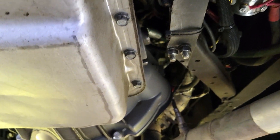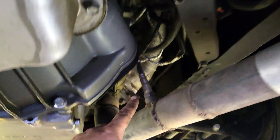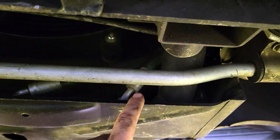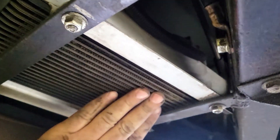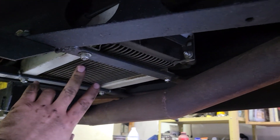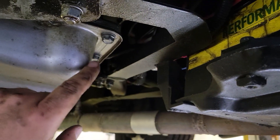This might be difficult to see, but I'll try and show you. Transmission lines are here. It comes out of the transmission, goes forward through the frame to the radiator. And it goes from the radiator back through the frame again, all the way over here, past behind the battery to this cooler, which has two big fans on top of that. So it'll come into that or from there, come out of that into this new cooler here.